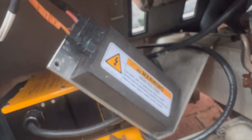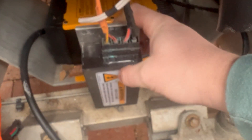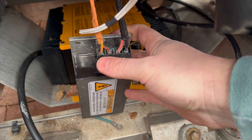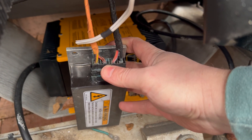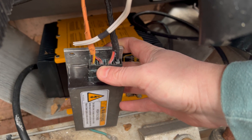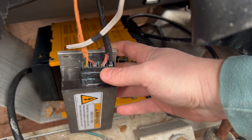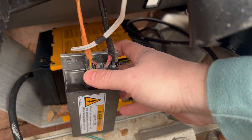This is an aftermarket DC-DC converter, but your original one will look something like this and will be riveted right here. Mine has gone bad so I've replaced it. Another thing to test: if you're not getting 12 volts on that test where you bridge pin 4 and 13, you can test here — this is the input to the DC-DC converter. This side is 72 volts positive, and this is ground. Test with your multimeter and you should see 72 volts here. You can then test the output side — this should be 12 volts, and this is low-side ground; you should see 12 to 13 volts coming out. If you don't see 72 volts coming in, you probably have a fuse problem under the seat.